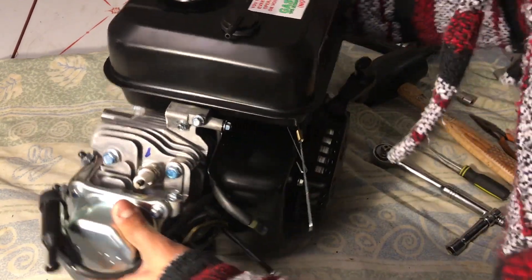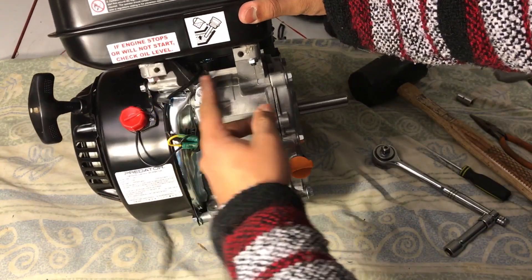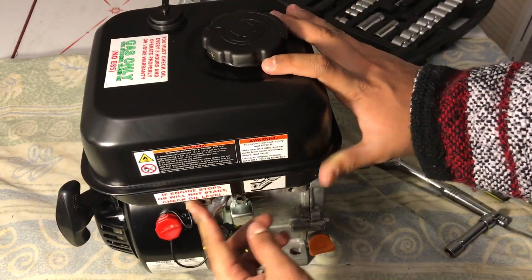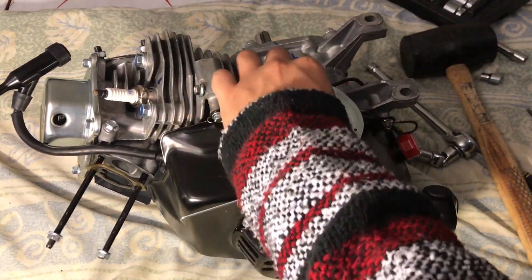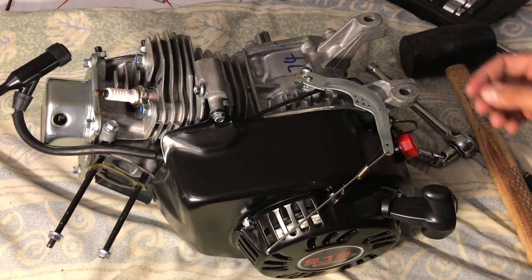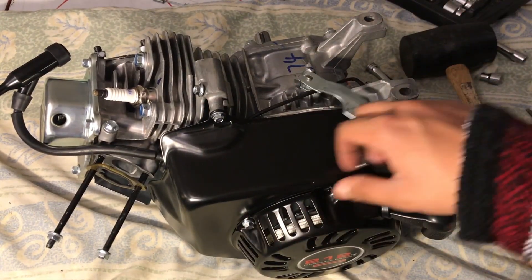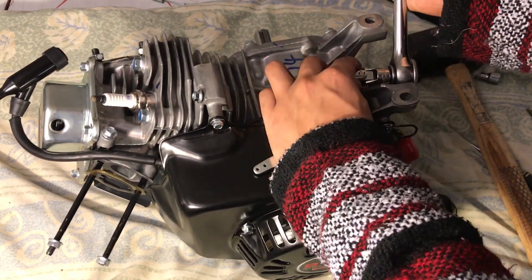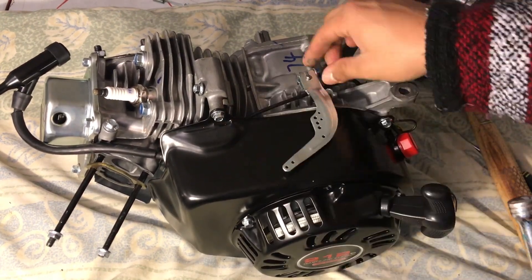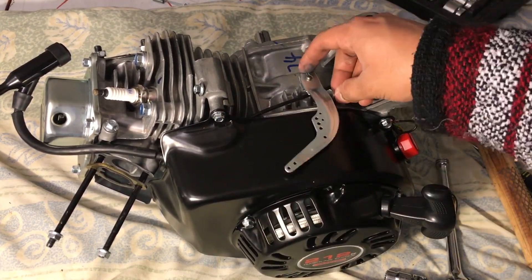The gas tank I'm not really going to show, but it's just 5/16ths for that bolt back there and then two 10-millimeters — it'll just come right off. For the governor arm, to get those springs out, you just move with it, push them down, get it out. It might take a little bit of time but it's not that hard. Then go ahead and take that 10-millimeter bolt out and just pull it out. You won't really be needing that screw anymore.